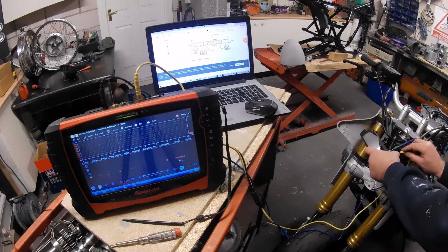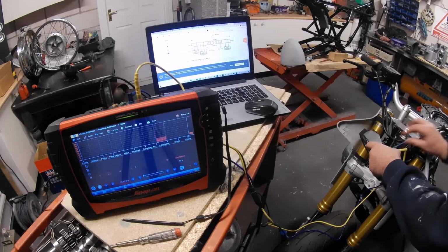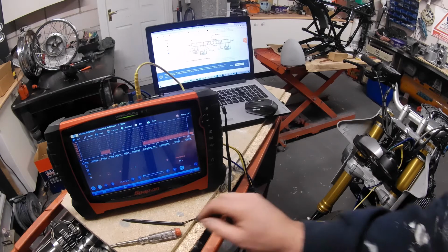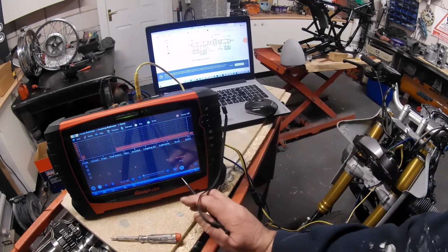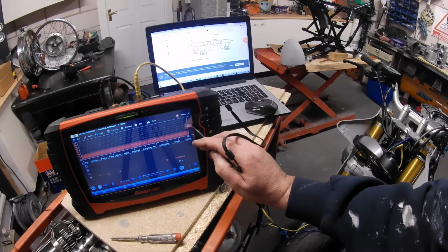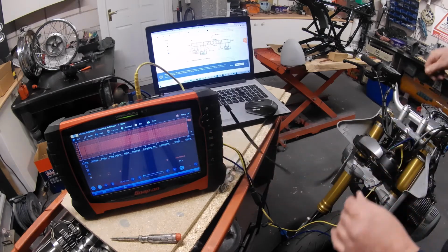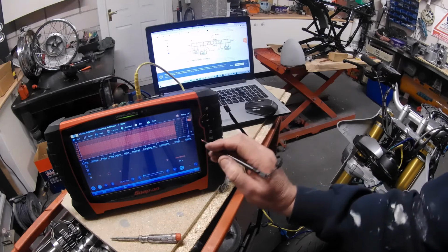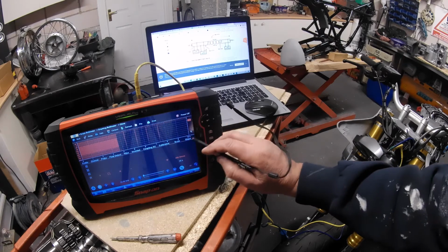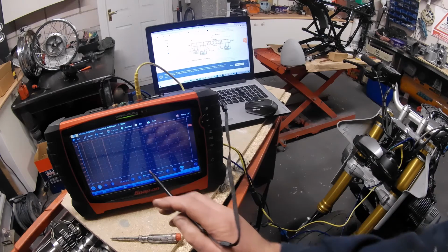And in the other CAN wire, I'm just back probing behind it. We're not doing any damage to the terminals, we'll just back probe behind. If we can get a reasonable reading. So our reading now, we're on. Turn it off. Wait for it to shut down, for the nodes to shut down.